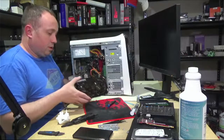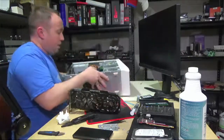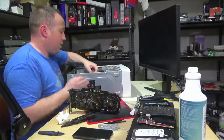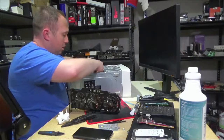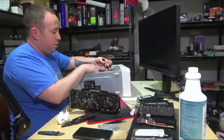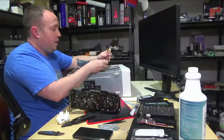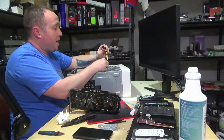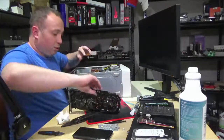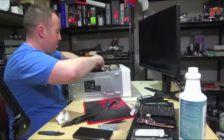So we still got to keep pushing here. Let's get the 770 in its home, and in order to do that, I had to do a little bit of a no-no. This card comes with 2 6-pin connectors that end off the same wire from the power supply, so I put an adapter on one of those 6 pins to turn it into an 8-pin. So this is going to pull as much as that wire is safely rated for, and maybe a little bit more.